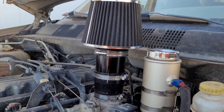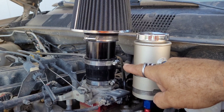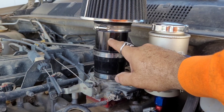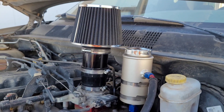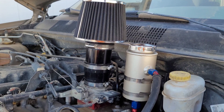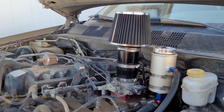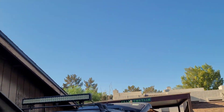It's the cool air intake from Amazon — two and a half inches on one side, and the throttle body is three inches. I cut the little piece of pipe to four inches and it came out the way I wanted. The air filter is three inches — pretty much a generic cheap air filter, and that's how it goes. Hopefully it works for you guys. If not, it's okay — this is Frankenstein. We'll see you guys next time!